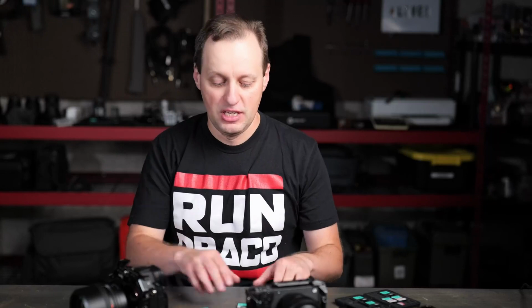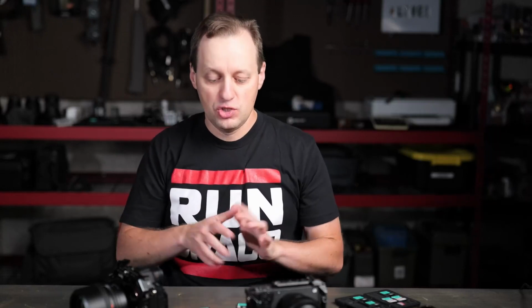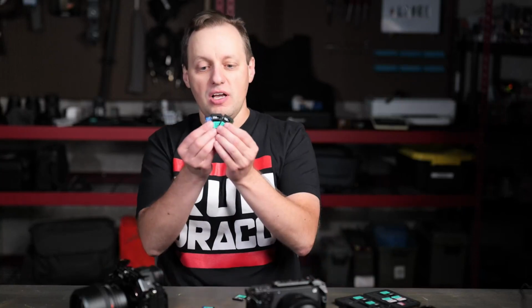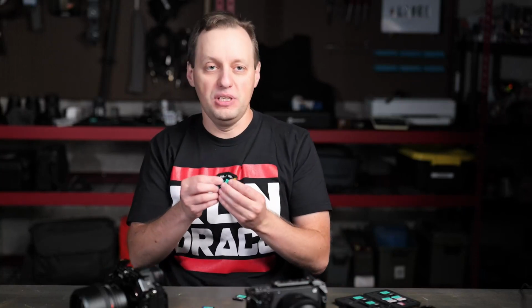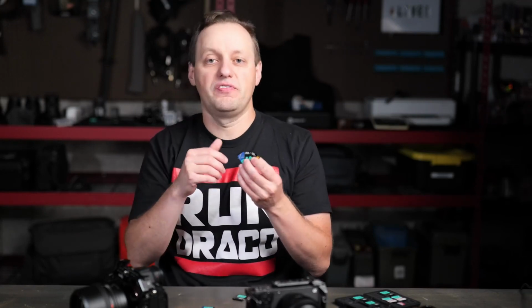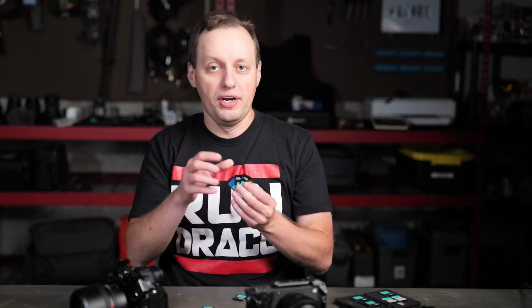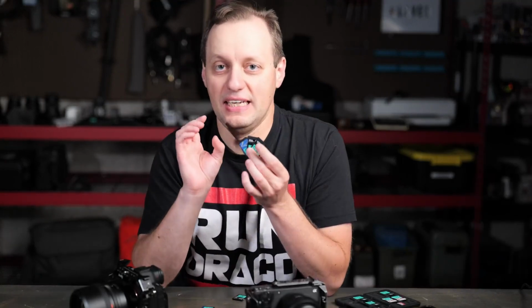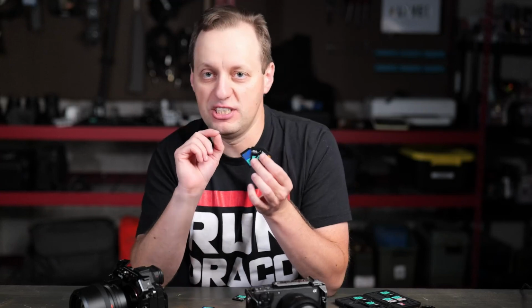So let's break it up between whether you are a photographer or a videographer, because that's going to make a massive difference between which card you should choose. So what do they all have in common? All of these cards, and I'll just pick one of each, are going to be Class 10 U3 V60 cards, which means that they are going to be just fine for taking sustained photos. And when it comes to video, these are all rated for sustained 60 megabytes per second write speed.